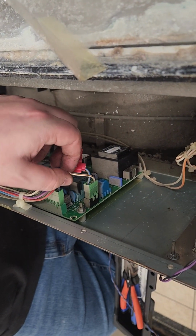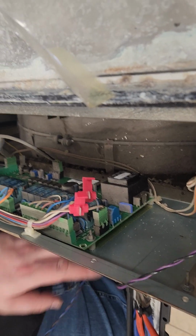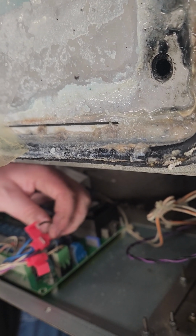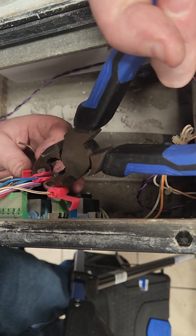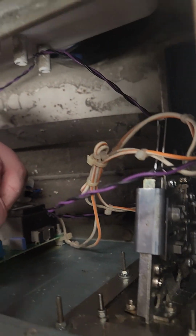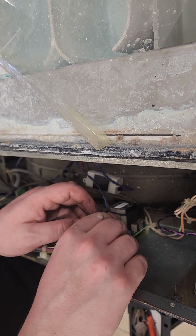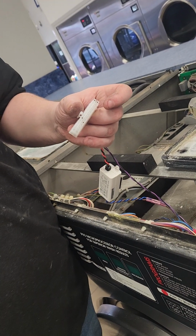Make sure that they're placed on the wires correctly. Then connect our blue wire to the blue wire on the machine. Make sure that if you're using vampire taps, you squeeze them down enough. Finally, attach the MIB to the end of the 24-pin connector and mount the MIB inside the machine.